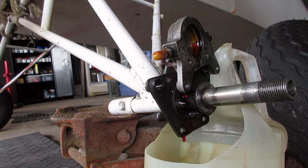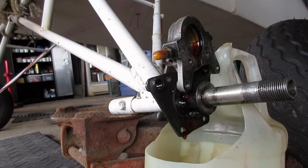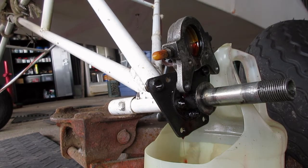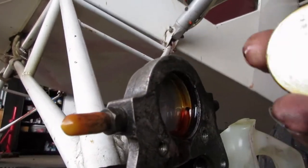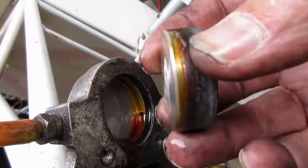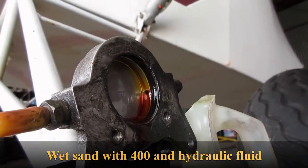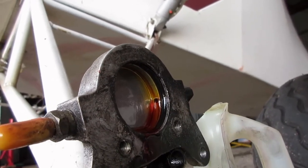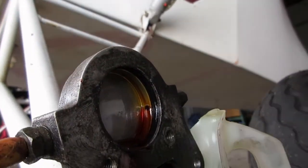Here you can see the piston is out. To get it out, I put my hand over the piston and caliper assembly and stuck my other hand inside the airplane and gently pushed on the brake pedal and popped it loose and lifted it out. Easy peasy. So there's the O-ring in the caliper. There's the piston — it's kind of cruddy. We'll go after that with some Scotch-Brite, clean it up. And I'm just going to let it drip; I don't care if I lose the fluid. The O-ring doesn't look terribly bad — we'll see what it looks like when I get it out.